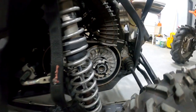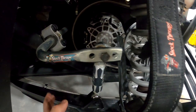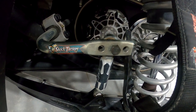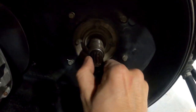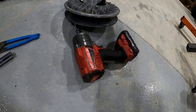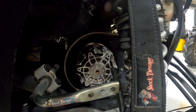I'm going to pull this off — just a 17-millimeter bolt in there. I'm going to need to take this top bolt off of the sway bar link; that'll fold down and we'll be able to access the primary clutch bolt, which is a 22-millimeter. I'll get that off and then show you the not-so-secret way of doing a pro job pulling a primary clutch off. Secondary is off — you don't need a puller on this one because it just rides on splines, there's no taper. And there's the primary bolt out, just using the Milwaukee. That thing gets the job done every time.